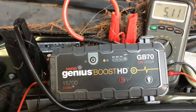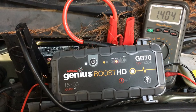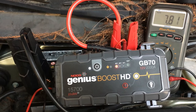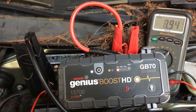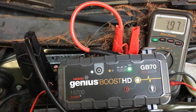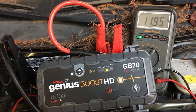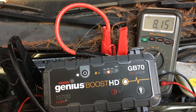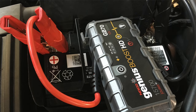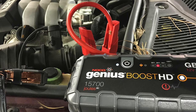Here's where I wanted to put my multimeter on the battery while using the jumpstart pack. This is the vehicle that actually didn't have the fuel pump hooked up, so it would have never started. We're looking at starting with a battery at about 5 volts. You can see it slowly jump up. The total time of this video was about 7 minutes. You can see eventually it'll get the voltage up to nearly 11.5 volts. This battery was super dead — this car sat for a couple of years — so I'm not surprised it wasn't able to bring it all the way up. But it was able to start each other vehicle every time.